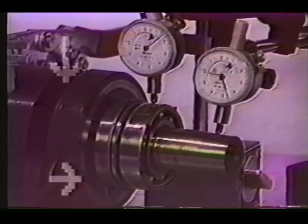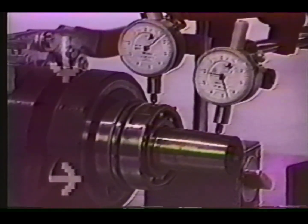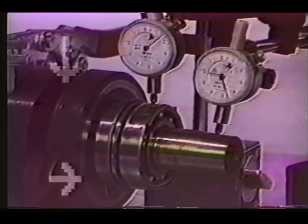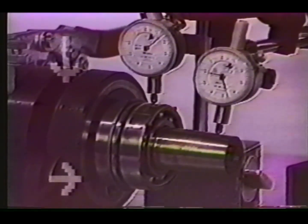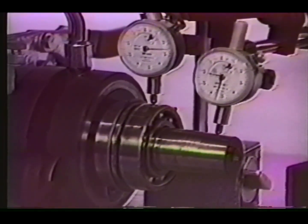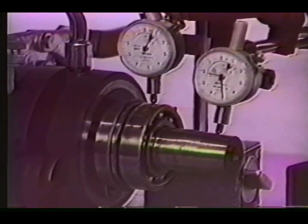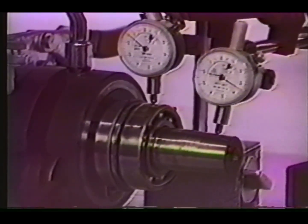In this position, the dial indicators are showing that the high part of the crankshaft is with the rod positioned in the down position. The inside dial indicator shows about 1.5 thousandths, and the outside end of the shaft almost 5. This will require that the crankshaft be spread with the 1/2-inch adapter. We are using the adapter method instead of the wedge, as we feel the wedge method is just a little bit too abrupt. The adapter method is just an easier one, and it's a lot easier on the shaft. Again, you must remember that the dial indicator in relation to the rod pin tells you the action necessary to straighten the crankshaft.